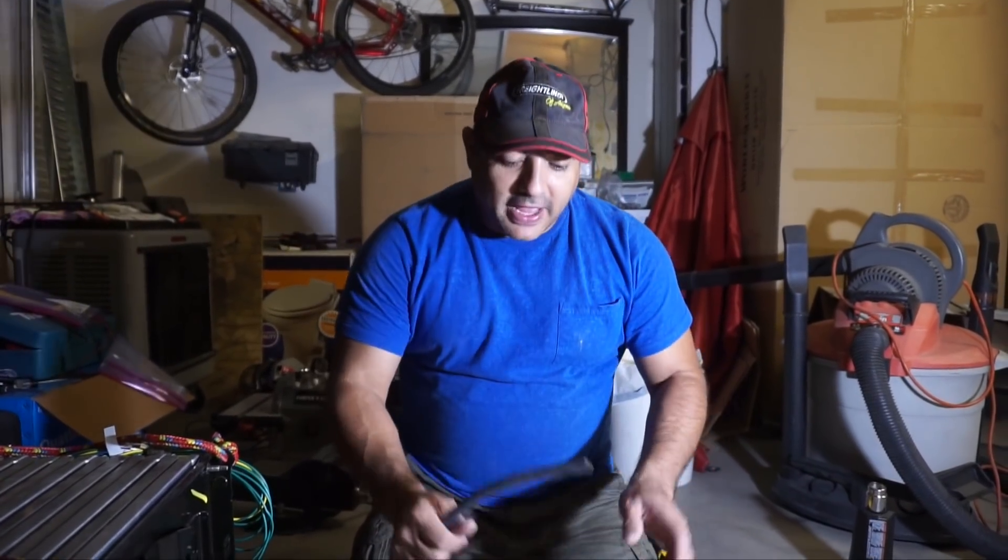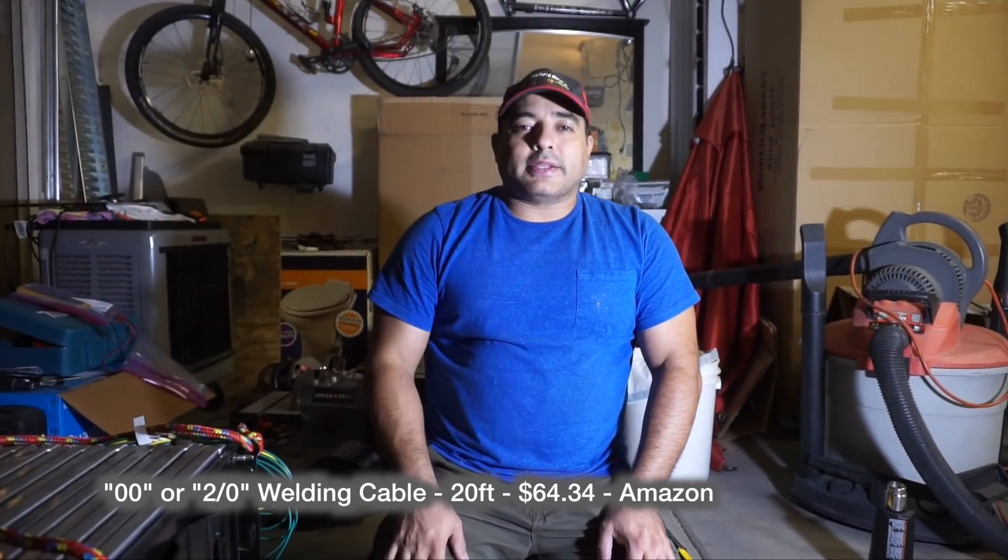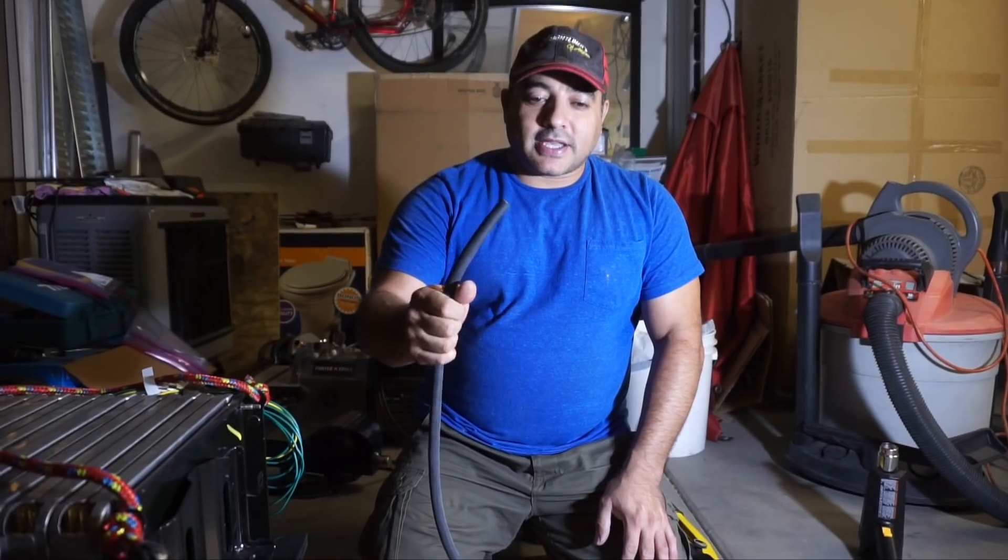Tonight we are wiring one battery to the other. We ordered a bunch of stuff last week, mostly this cable. We're using a double-aught cable to connect the front to the bottom battery, because when we built this battery it's seven in parallel tied to seven in series. The seven in parallel ends up split between the two — four on the bottom and three on the top — so we needed a way to tie those together.